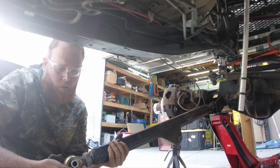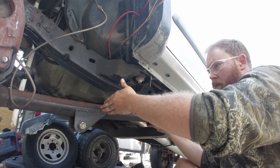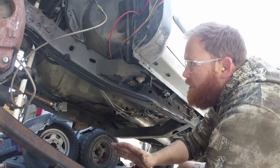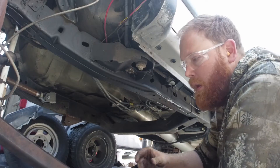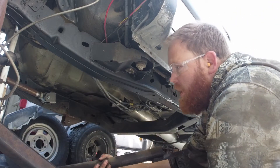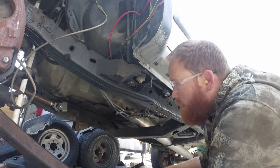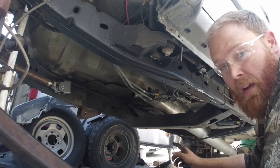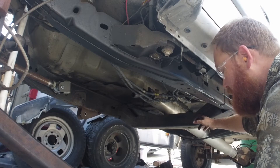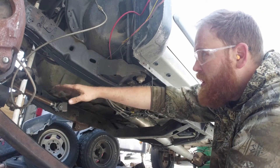I'll leave a little bit more than that here so you guys can see where it was — almost an inch to an inch and a half inboard below the frame — so that even if I were to do it, it would just rub the frame and the bar and everything would be good. I'm going to bolt this back in, at least for mock-up purposes, bolt my high clearance transmount back up there temporarily. I need to figure out a way to either manufacture a cross member here or something. I need to get my links figured out, my transfer case drive shaft figured out because of the doubler, and know where that is in relationship to this torsion key cross member, which is likely going to be quite a bit in the way. I might end up cutting most of this out and just having a plate under it.